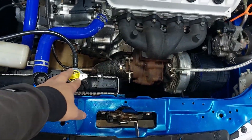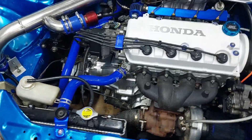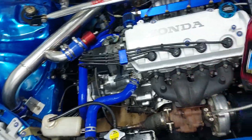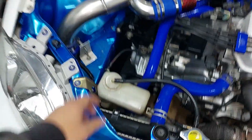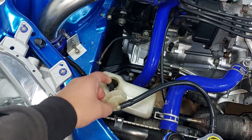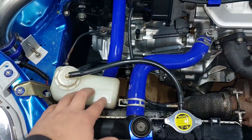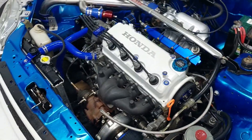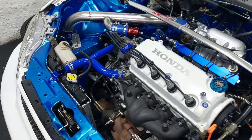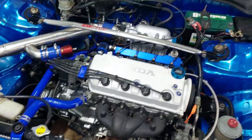Everything is back together. I put water in the radiator — just water for now — because if something is wrong and I put coolant in here, it would drain out and you'd waste it. I am going to flush it. I did get some engine flush because with the head gasket leaking we had some oily residue in the coolant system, so I'm just going to flush it with radiator flush to make sure the system is nice and clean, and then if it's not leaking anymore we'll put coolant in. The way I knew the gasket was blown: it kept pushing tiny bits of air bubbles into this reservoir over here. So if the car is at temperature you can look in here and see bubbles being pushed into the overflow, and if I boosted the car you could see the water splatter from actually spraying out of here. It didn't smoke or mix oil and water or struggle to start or anything like that — I probably wouldn't even have known if this car wasn't boosted.